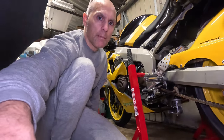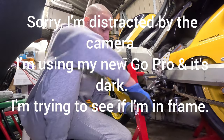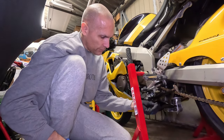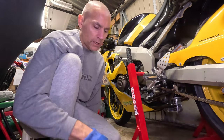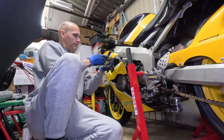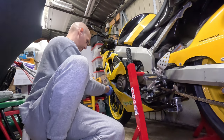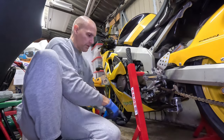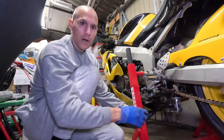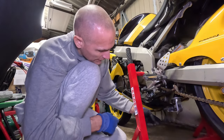I'm really sorry because we're mega cramped here. Hopefully you know how to take the left-hand fairing off. I've got a bolt just at the bottom here - these are already loose because I've undone them. There's one at the top as well. I'm not going to speed this up because I want people to be able to see it. So I've literally just undone the bottom so it's nice and loose, and I can manipulate that. If you want to take it completely off you can - I just don't bother. All I need is basically access to this bottom bolt.